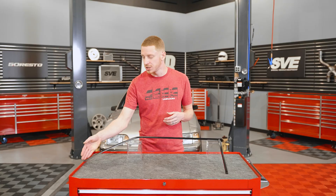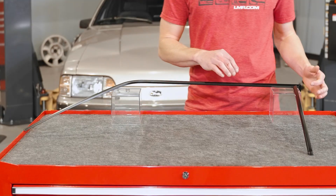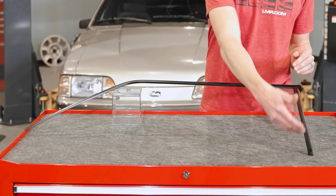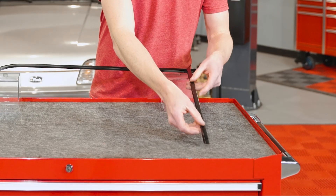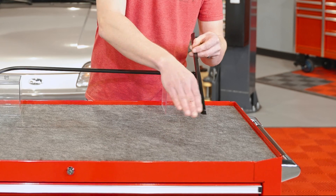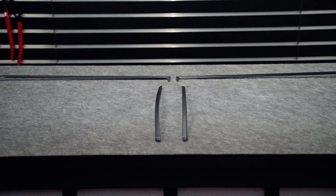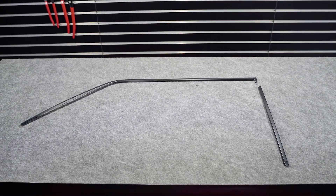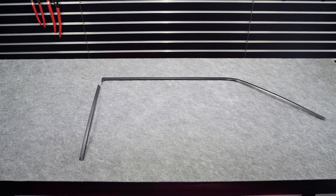You'll have your little plastic end cap here — this piece is what touches or gets very close to the mirror. You'll have your little L bracket that connects your boomerang or upper section with your vertical piece. If we take a closer look at the vertical piece, you'll see the little indention down here, which is where your outer door belt rolls over. In the box, it's pretty simple: you're going to get a driver or left-hand side and a passenger or right-hand side window run channel trim.